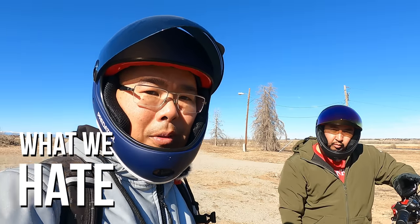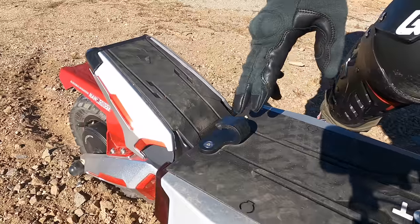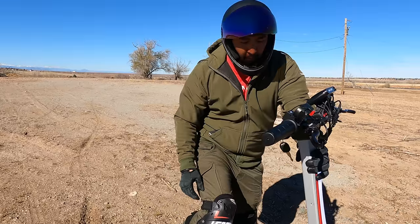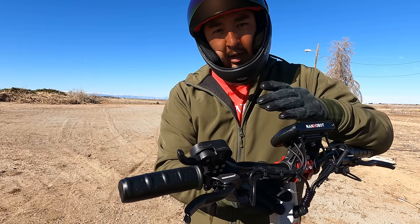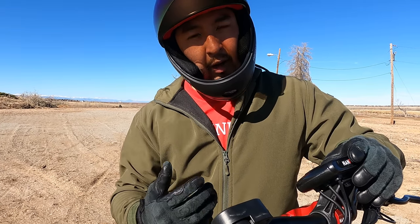The biggest issue for me is that a lot of things were damaged in shipping. This kick plate is nice and big, but there's a hook that connects into the steering pole and gets in the way — if you ride with your foot in the middle, you just have something in the middle of your arch, which is terrible. The other issue is there's no local dealer — you're going to have to wait, only serviced by Nanrobot directly. A 60 volt battery would make this scooter awesome; I don't know why they'd upgrade the D6 Plus and leave it as a 52 volt scooter. Nanrobot also needs to quit using cheap battery cells — this is not a Samsung or LG cell; it's likely DMEGC battery cells.